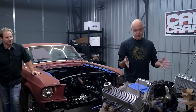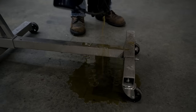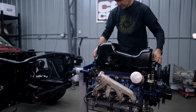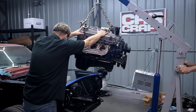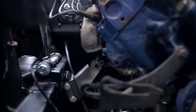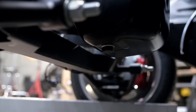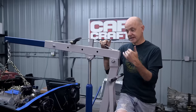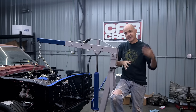The next step is to get our engine prepped — get the oil pan back on, clean it up a little bit, and then it'll be going right back in the car. The Windsor has a taller deck height than a typical small block, so we've got to get creative dropping this thing in with a conversion pan and things like that. But it's worth it for the extra displacement we're going to get. We got the oil pan in place and it fits — it clears the steering rack and steering lines. This engine originally had a front sump oil pan. This is a low-profile dual sump and it clears everything. It sits in low enough that the stock air cleaner will fit under the hood. So the next step is to get the engine back out, put the oil pan on permanently, and then put the transmission on the back of the engine and get everything reinstalled.